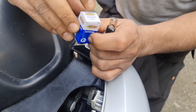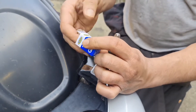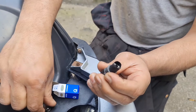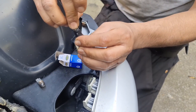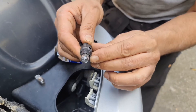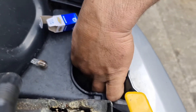Now the bulb you need is a 501 bulb — you can find that in the description if you want a link for it and where to get one from. This is what we're replacing. Take it out, get the new one in — there's only one way — then just slot it in. Remember the rubber seal around here as well. I'm going to slot it in first, make sure it all lines up.